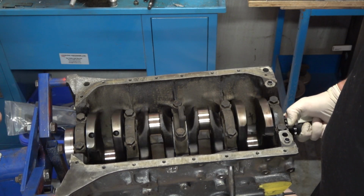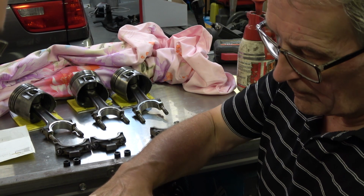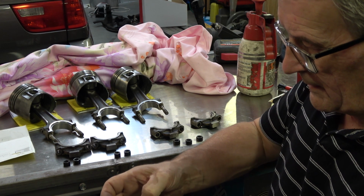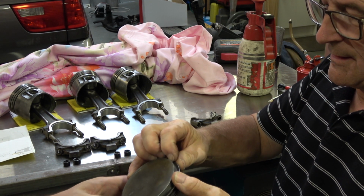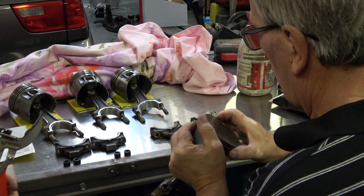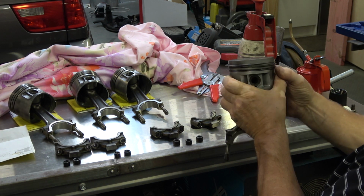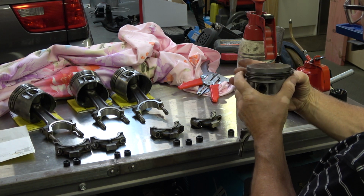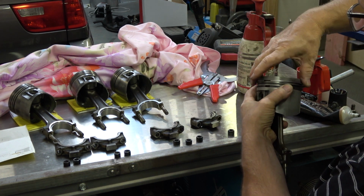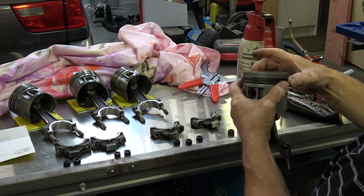Just as easy as it did before. Totally good. Push that in. I'd rather do it with my fingers. It's probably easier. Yeah, that is. Are we going to use anything on this kit? No, well, probably just the cylinder bore compression thing. Yeah, right. So we've got oil gap there, middle gap there, top gap there. Yeah, just spread them out. Yeah, they are spread out.